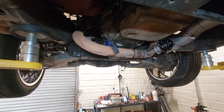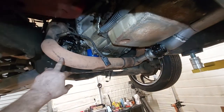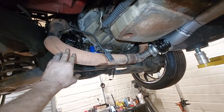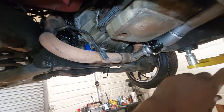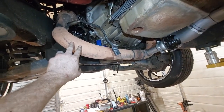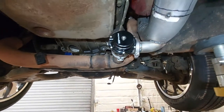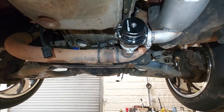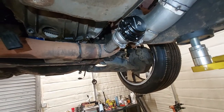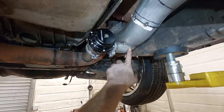We're back on the Red Snapper. We got the crossover made — this was the passenger side piece off the 2500 that came over. I cut it and repurposed it to make our crossover here, so it goes in and goes up to the Amazon log and our VS 44-millimeter wastegate. I wanted it on this side so we can tie it back into the exhaust.